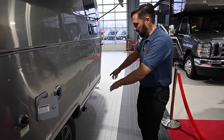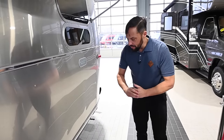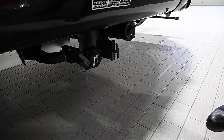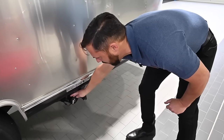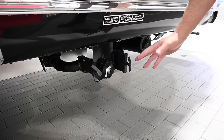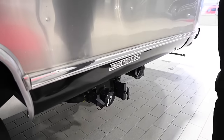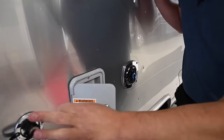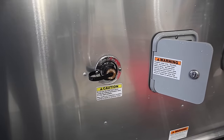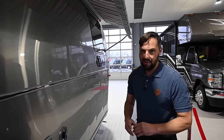For the black tank flush: we give you a waste hose and a storage tube under the trailer to slide it into. When you're ready to empty waste, snap on your waste hose and always empty the black tank first by pulling the handle, letting it gravity drain. Once done, shut it and open the gray waste — that's your soapy sink and shower water, which washes out the hose. To flush the black tank, connect a regular garden hose (not your drinking water hose) to the flush inlet, and under pressure it will flush out residual waste from inside the tank. Always follow the procedure in the owner's manual — you must have the valve open before connecting the flush, otherwise pressure will build and flood your trailer.